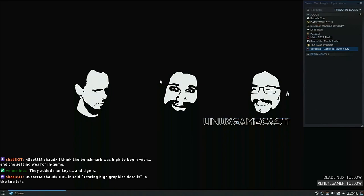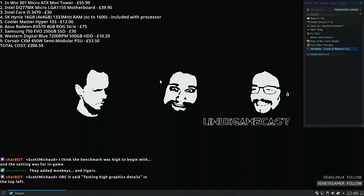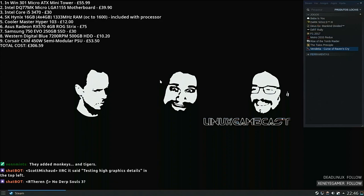That was it. That was El Cheapo. Let me put the specs back up. Inwin 301, DQ77 motherboard, an Intel i5-3470, 16 gigs of SK Hynix 1333 overclocked to 1600, Cooler Master Hyper 103 on the processor, an Asus Radeon RX 570 4GB ROG Strix, Samsung 750 EVO 250, Western Digital Blue 7200 RPM 500GB, and a Corsair CXM 450W. All of that for these scores that you saw just now, £306. Honestly, that's pretty good.